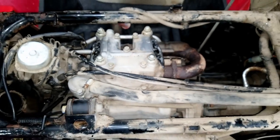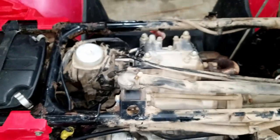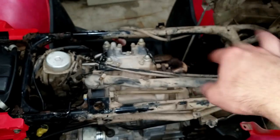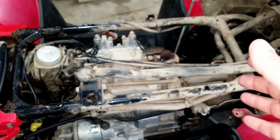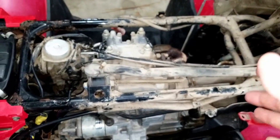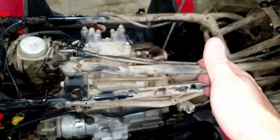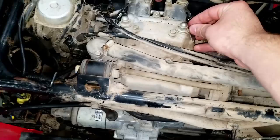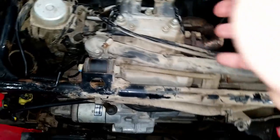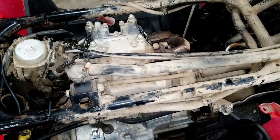That's exactly how you check the valves on a 2006 Honda Foreman Rubicon. I would highly suggest bringing your tank over and buttoning everything back up, then try to start it without all the plastics on to make sure your valves aren't ticking as bad as they were before. I did try that already — I started it, but I don't know if it's just the Honda engine that's crazy loud or if it is actually a valve issue, because these valves are adjusted absolutely perfectly and I'm still getting a lot of drivetrain noise. We'll put it back down and I'll show you what I'm talking about.